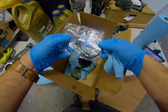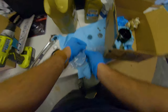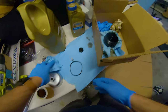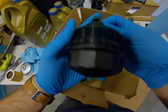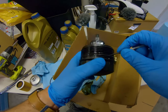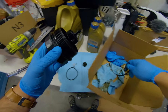Once you think all the oil has dripped out, remove the oil filter and throw it into a ziploc bag, or put it on top of your oil drain pan and let it drip for a couple of hours. Now look at the oil filter cap — there are two o-rings: a little o-ring at the tip and a big black o-ring on the main screw housing. Be careful removing these; don't use sharp metal tools that will nick and scratch the plastic. Use something dull or plastic to pry off these o-rings, and replace them with the new o-rings that came in your oil filter kit. Make sure you have the right oil filter kit before starting — you don't want to end up halfway through and not have the right o-ring.